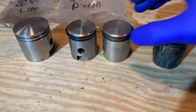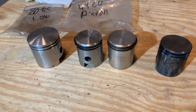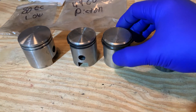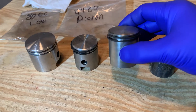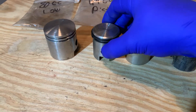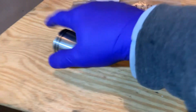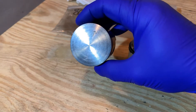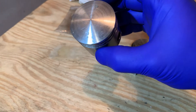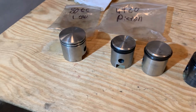Here's where you as the mechanic have to decide which way that piston goes. One thing I have always noticed on little two-cycle bike motor pistons — this is just an 80cc for example — it has its number two and an arrow to help you the mechanic put the piston in the desired direction.